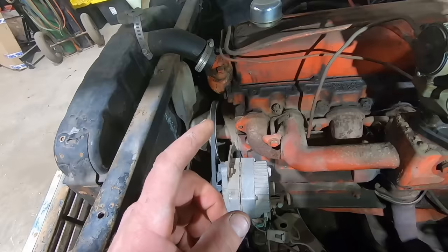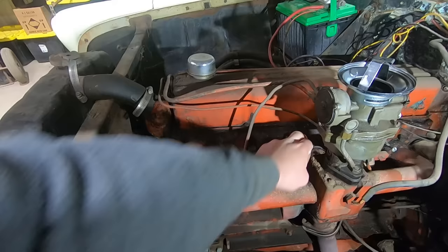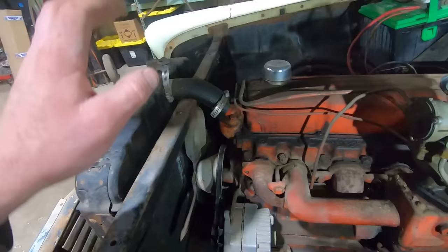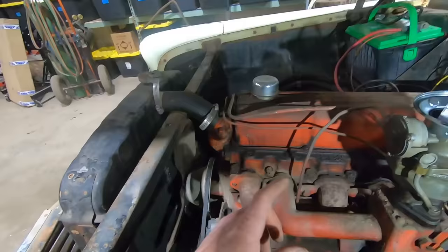235, this should be a full pressure 235, not a dipper style or Babbitt or whatever you want to call it. It's got the 848 head. That's one of the good ones. Six-cylinder cars, the radiator is ahead of the core support. V8 cars, it's behind it because obviously a six-cylinder is longer. I think we need a battery hold down over there.